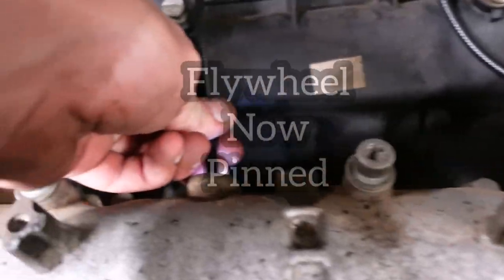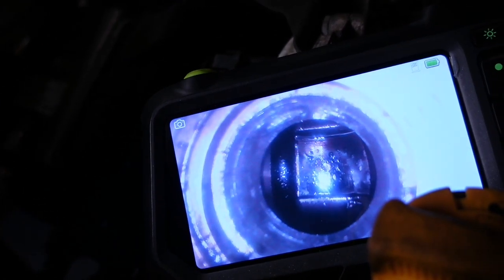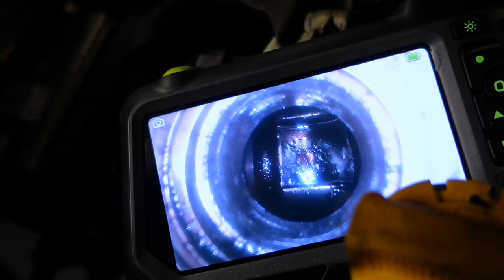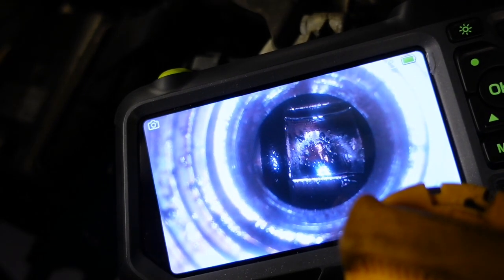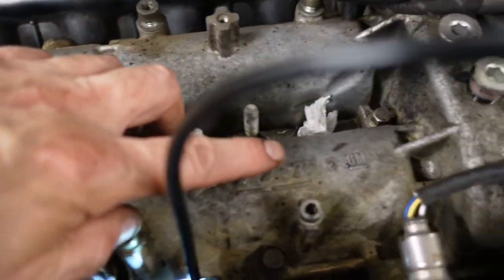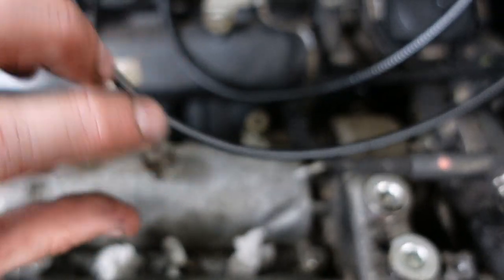With this wee bung out of the rear inlet camshaft, I have a camera on it - you can see that it's not exactly central, and that's because we have a stretched chain. So the locking pin will not fit into that. You can see the bottom horizontal line needs to go down a wee bit more. The exhaust camshaft has one cam wheel driven by the chain, and there are two cogs geared together - one spinning clockwise, geared to another cog in the inlet camshaft.